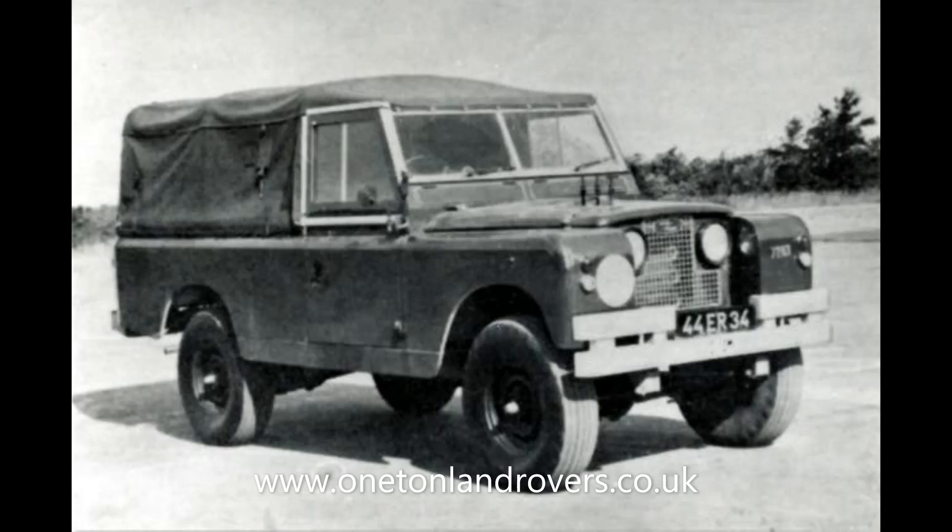The origin really lies in two places. The image on screen at the moment should be of a military 2A on what appear to be 900 by 16 or 900 by 15 SAM tyres. This is a British Army vehicle, but by the early 60s it's thought to be an Australian-origin modification — that the vehicles would have extended spring mounts to allow them to run larger tyres. Certainly by about 1960 or 61, 916s or 915s were an optional fitment on 109s, as I remember seeing in a pretty early workshop manual or salesman's manual for either very late Series 2s or very early 2As.